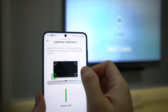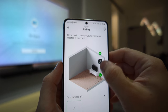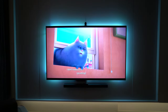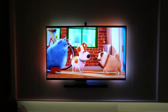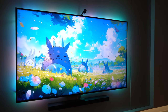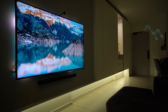Again, for all camera-based sync, you will need to calibrate the camera. If you have other Nanoleaf products you'd like to sync together, you can easily add the placement inside the app. For Nanoleaf, you can set the mirror modes: 1D, 2D, 3D, or 4D. 1D gives you simple white ambient lighting. 2D gives a single color to the strip based on the screen display. 3D gives multi-colors, and for 4D you see fewer colors but it includes lighting effects and varying brightness, which becomes a little too much at times. There are also vibrancy settings: Cinematic, Vivid, or Custom. Cinematic tones down the RGB by a lot, while Vivid showcases Nanoleaf's RGB to its full potential. If you have other Nanoleaf products in the setup, it syncs very nicely with them — I have the Nanoleaf Lines at my front door area.